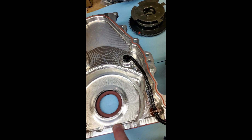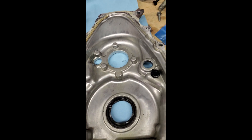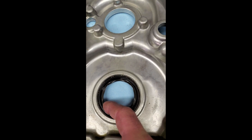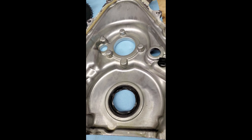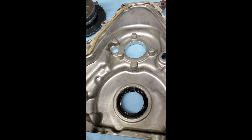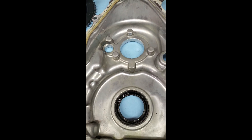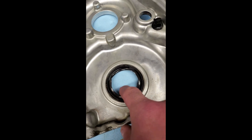The last thing I wanted to touch on — not necessarily related to the timing cover — is the stock LT4 front main seal. You can see it is a mess. I was at Road America before I had a catch can and learned the hard way that if you do any kind of modifications or run your car hard, get a catch can to evacuate the crankcase blow-by pressure, because this stock LT4 / Gen 5 seal is just weak — it is a definite fail point on these cars.